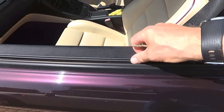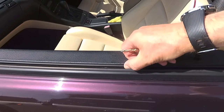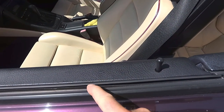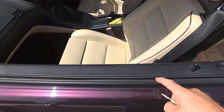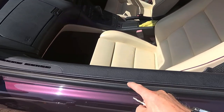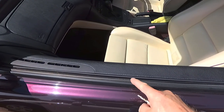The inner one's usually not too bad, it's usually soft and pliable, and has a bit of felt on the face of it to clean stuff off the window. The outer one isn't quite so resilient because it will build up pollen on this edge and then get lichen on it, and once it's got lichen on it the lichen becomes very hard and as the windows go up and down it will scratch them. Not only that, it will stop the primary purpose which is to stop water getting into the door card.